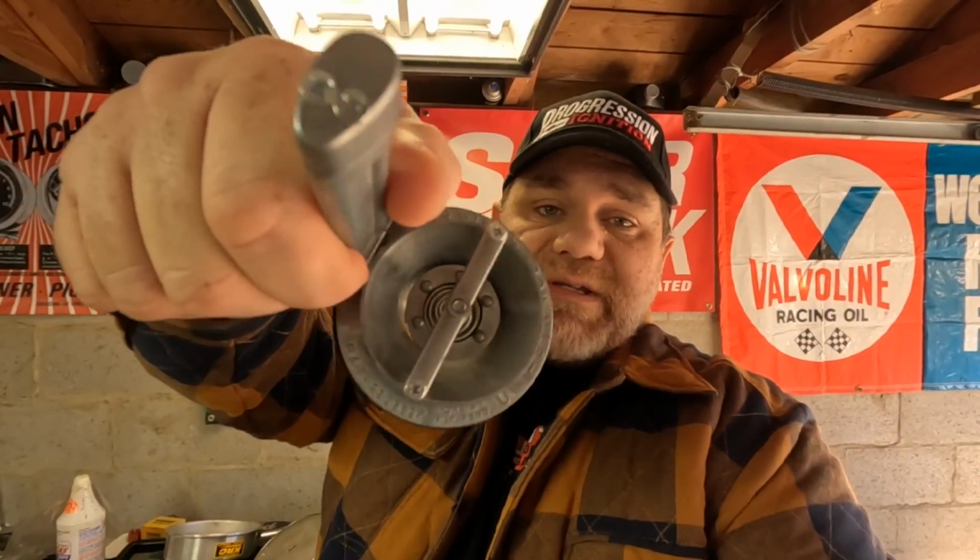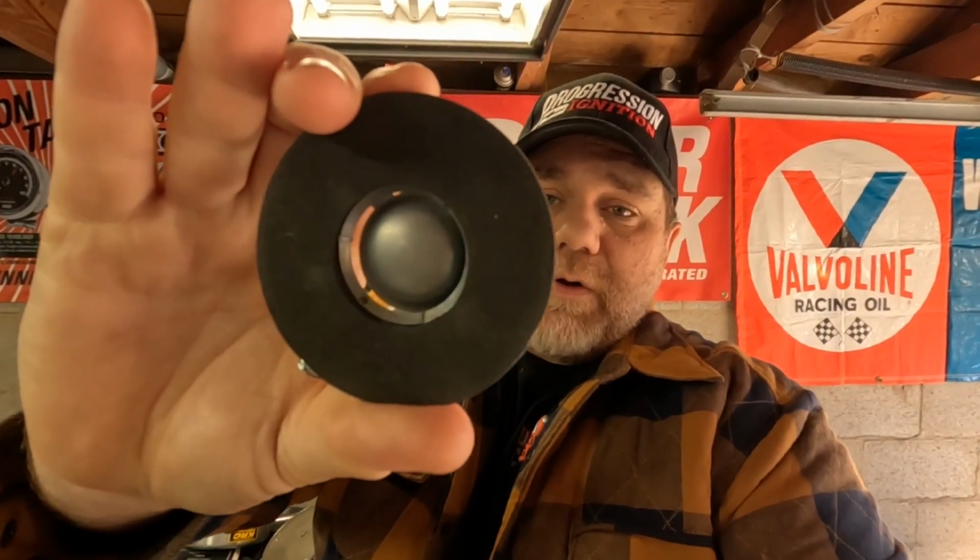Now, the thing about it is, this is not going to really affect any kind of wide open throttle performance, but what it will do is make the combination much more enjoyable to drive around town and everywhere else. So how do we go about making this tool? That's where you enter the Edelbrock Uni-Syn. Pretty cool device. It's actually meant for early 2-barrel style carburetors, even 1 barrels, and it has a floater valve in it which changes with the depression of the amount of airflow going through the valve itself. Think of this as a primitive mass airflow meter in today's vehicles.